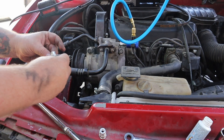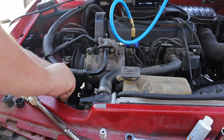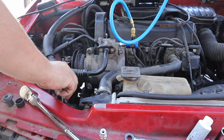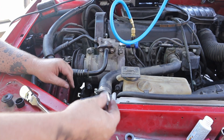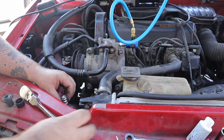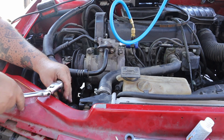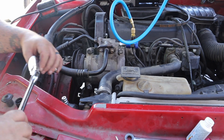With the oil in the system, hopefully it should be enough. I'm going to go ahead and reinstall this Schrader valve. I think this is the accumulator — I could be wrong, don't quote me on that. Leave some comments below if you know what this part is. So there's the Schrader valve and here's the retrofit fitting. We're not going all gorilla torque on it.